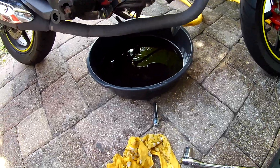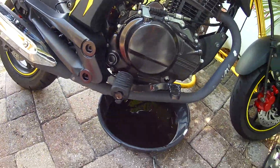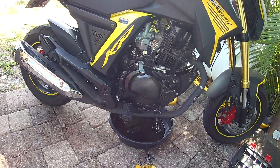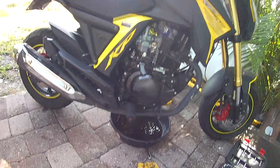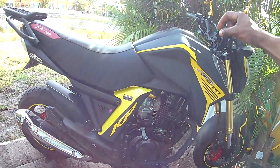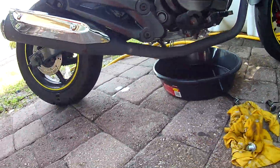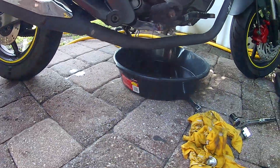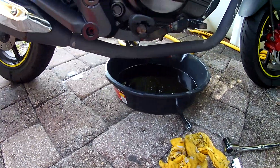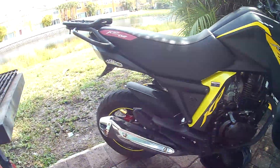11/16 bolt is pretty easy to come out. Still got oil in there, so you gotta get your bike straight like that. You gotta pull on it and straighten it up so that oil gets out of the whole engine. Soon as I did that, see how much more started coming. So get your bike nice and straight if you're doing it without a stand, that is.